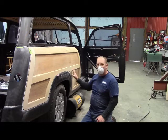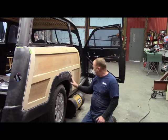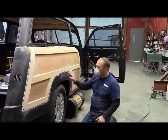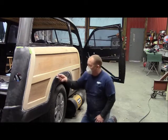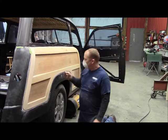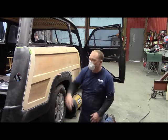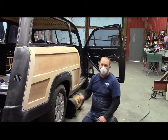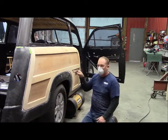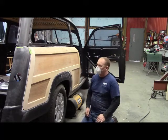This was the worst spot — the piece was out and I tried to pull it in but it doesn't want to move. It's shaped such that if I pull it in, it'll be like putting a dent in it there, so I just can't do that. I've taken it down quite a bit and I've got a little body work I can do right here. The way this changes on that radius is a little different than everywhere else. I'll fix that and do a couple more small adjustments. Having the cardboard on the back side and working this side, I'm just cutting it right to the surface of that surround. I'll keep adding layers of tape and running around it a couple more times to make it real consistent all the way around, then I'll blend it all in.